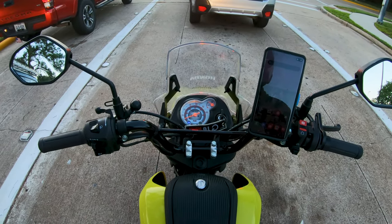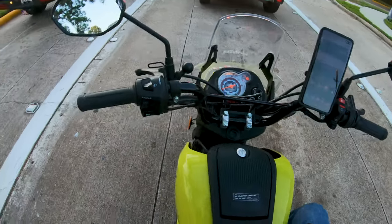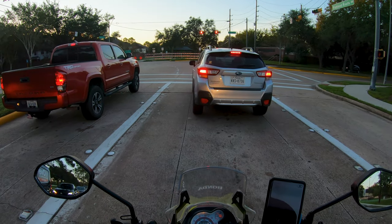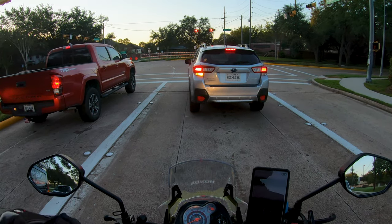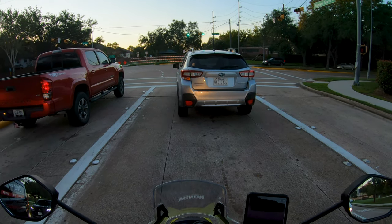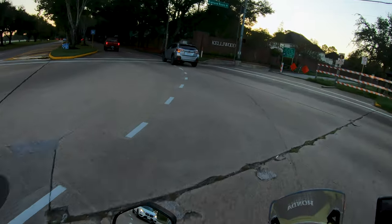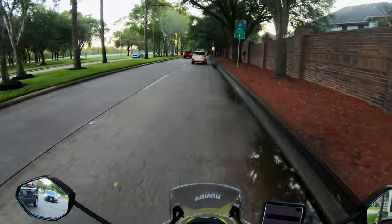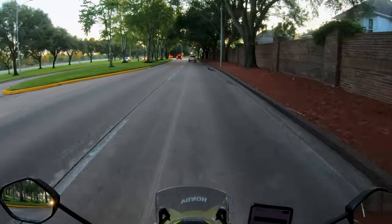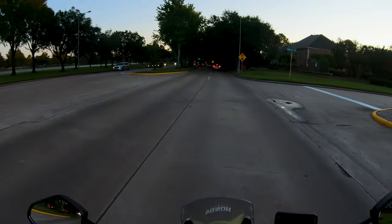So I've got the lighting upgrade, AC to DC conversion, variator sliders, can't remember, there's something else I was going to do to it. Oh yeah, carburetor, derp. The air-fuel mixture screw. I have an aftermarket thumb adjustable screw coming in from Amazon. It should be here in a few days. I think it's Kimimoto is the brand, but it's an extended thumb screw that would just replace the entire air fuel screw assembly. So we'll find out if it fits the Navi properly. I need to pull the factory one out of there and take a look at it, measure the length and the needle diameter, tip size on the end of it, make sure it's all the same. Otherwise I'll be introducing more variables. Don't want to do that.